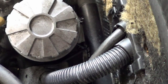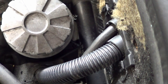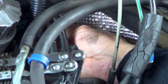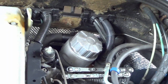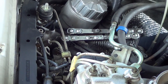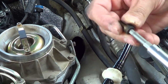You can see the culprit there between the firewall and the oil filter. I can certainly get my hand in there — very difficult to film, but I'm just going to get my hand in there with a screwdriver and try to take it out with this five millimeter Allen head. I've actually got it out. I've been using this little screwdriver set with a five on it and I've kind of loosened it. I can take out the screw — you've got to keep the screw. Go in there with your hand and there it is.